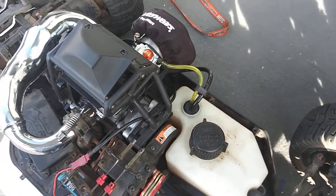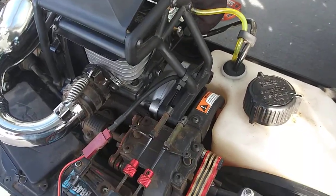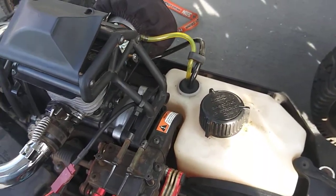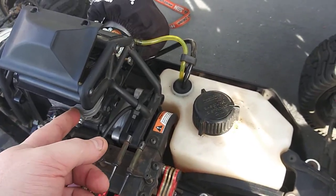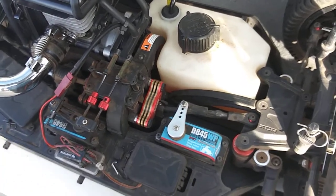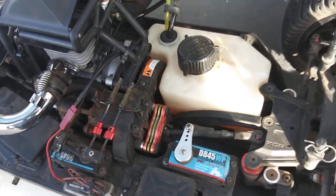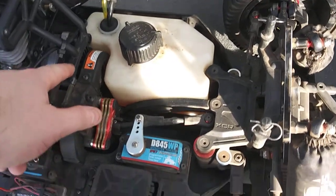That's why I'm re-breaking it in. It's got a new head, had a polished piston. This is like a performance head — pretty much makes it like a 320, maybe even a little faster than a 320 possibly. Got an 8000 clutch spring in there.